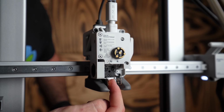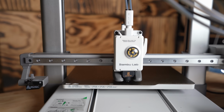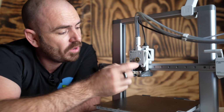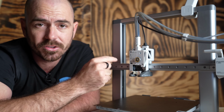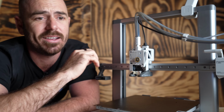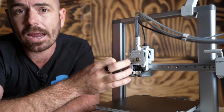And while we're in here, these 3 screws are the problem screws that can cause first layer defects on the A1. Because when the head unit becomes unstable, the bed leveling, which is actually achieved by the tip touching the bed, is interfered with by the wobble in the tip of the A1's head. So if you've got an A1 that you've been running for years or something, and you're having first layer bed defects, tighten those 3 screws and I guarantee all your headaches are going to disappear. This only becomes apparent after thousands and thousands of hours of use. It is a very small issue that you can fix in no time at all. It's just a matter of being aware of that issue.